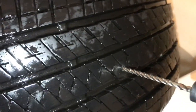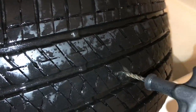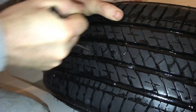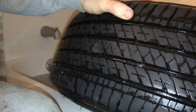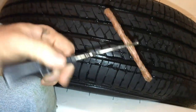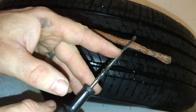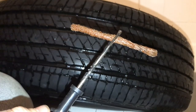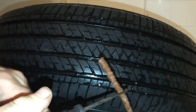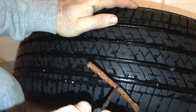We'll give a Slime tire plug kit a go. What we have is this tire plug — this is like a little spinning tool. We have our little plugs, and we're gonna feed them through the tool. You can see there's a little hole here, so I just pushed it through and then pulled it the rest of the way with my needle nose. They do give you rubber cement you can put on there — it's not necessary, but it does help it slide a little easier. I am out of rubber cement, so we're gonna just give her a go.